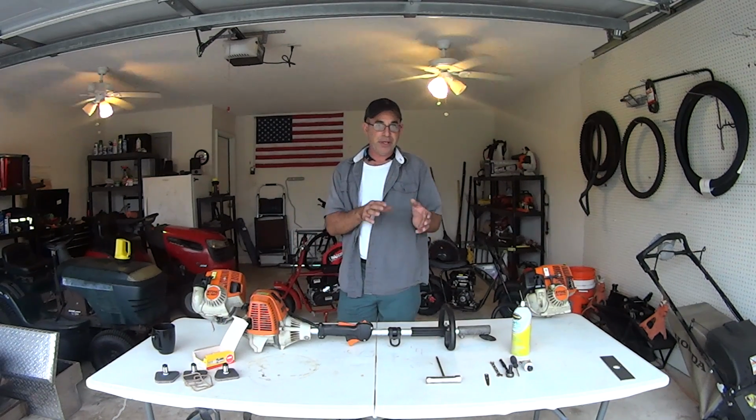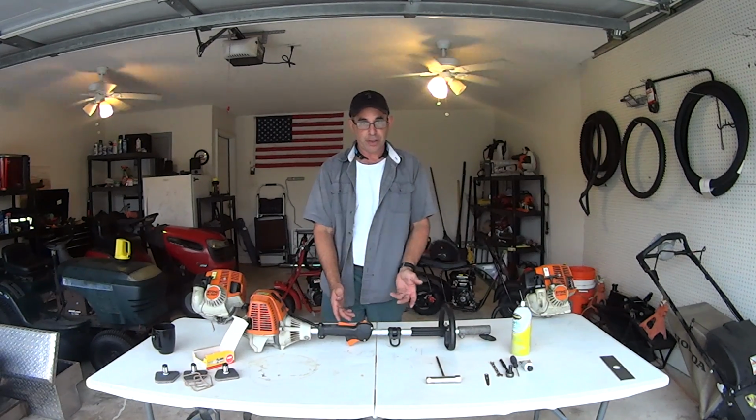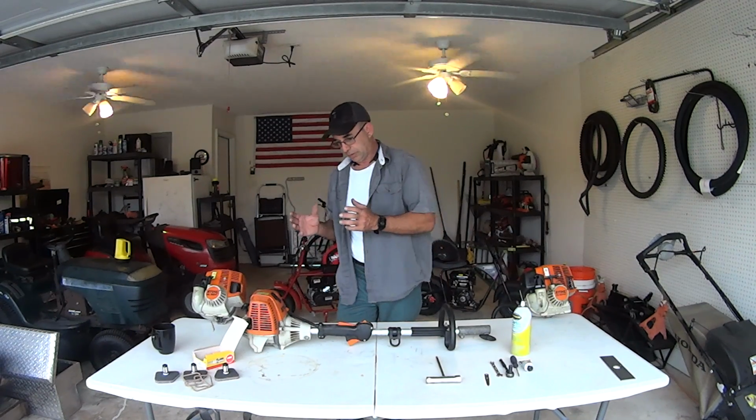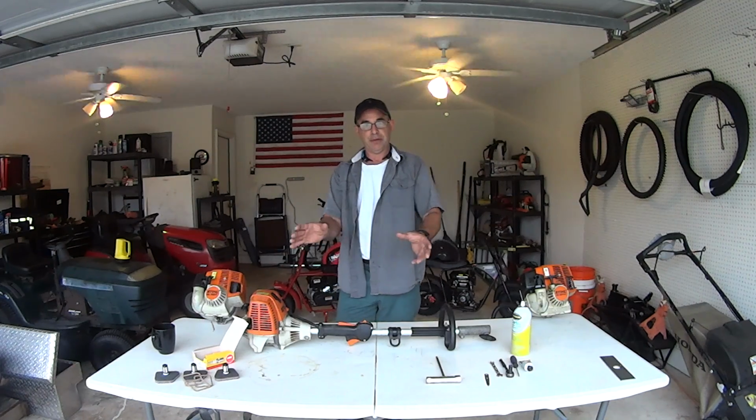Unless you have known issues, then you might need to clean your carburetor. But cleaning your carburetor is cleaning a carburetor. Cleaning a carburetor is not a tune-up. A tune-up is you're getting everything back to new. Filters, valve lash, get all that stuff straight.